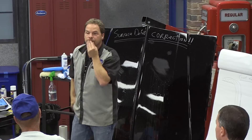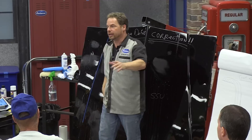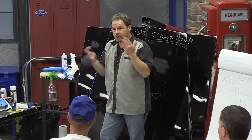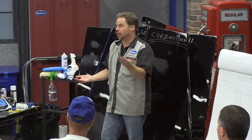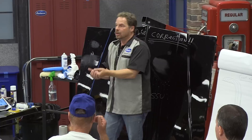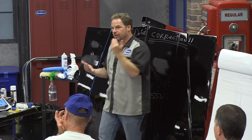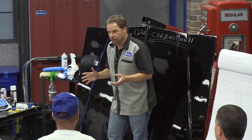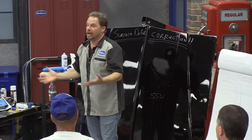What about sand and wait? Absolutely — I do this with primer surfacers as well. Solvent is the necessary evil of a paint job — it's the truest thing I can tell you today. For epoxy, that may be an exception because you've got a recoat window to take advantage of. When I'm using high-build polys or 2K urethanes, yes — sand it, let it evacuate, let it sit and cure. That solvent's coming out one way or the other. I've got a '34 Packard in my shop right now. It's one of 30 that were ever made, with a hand-built Dietrich body — an amazing vehicle. I get the privilege of doing the paint job on this car.